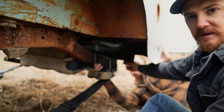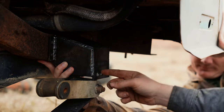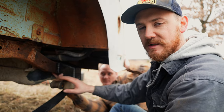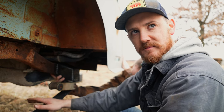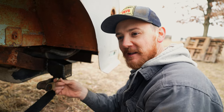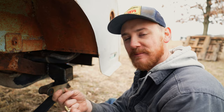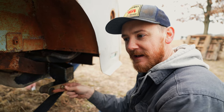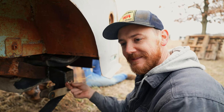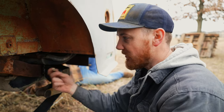The original hangers would have sat all the way back here, so we've got about six inches or a little bit more, give or take, to put it all the way up here — that's kind of what we're at right now. We had to make somewhere for this part to attach since these are shorter than the stock Jeep Commando spring. My brother and I both have fat fingers that won't fit between the gas tank and the frame to get these nuts and bolts attached. If we would have dropped the tank at the beginning we'd already be way ahead, but we're going to go ahead and drop it now — I'm not reusing this gas tank anyway.